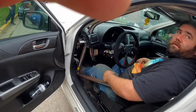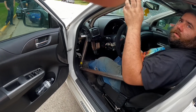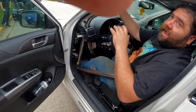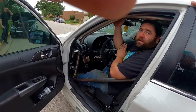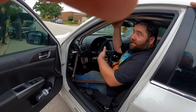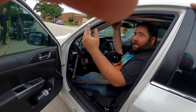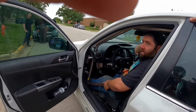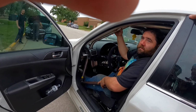Three pounds? Yeah. What's up? On the dyno, it was right around seven, like 6.5, 7. It says only 3 pounds. That's with nothing on the head. All right. But yeah, you just saw what I did. It's safe. So now, we get that converter in. But honestly, at this boost level, it can run. But when it was at 7 pounds, it's pushing through. Yeah, so get that converter in and we'll start hammering it.